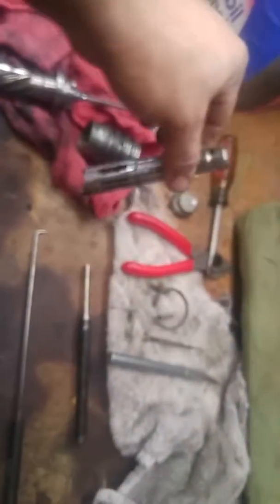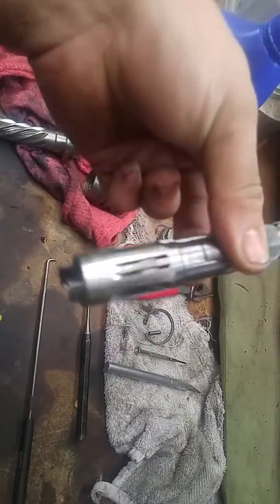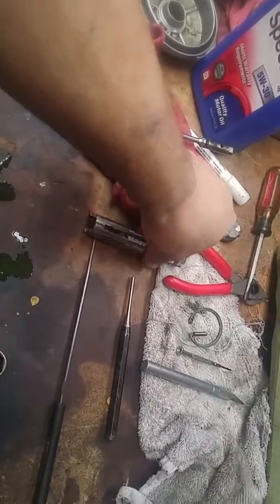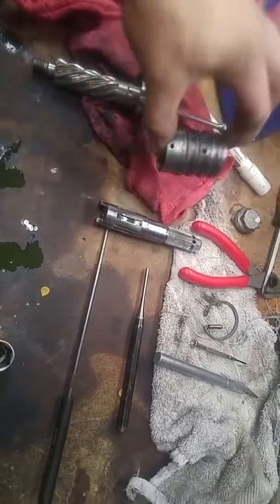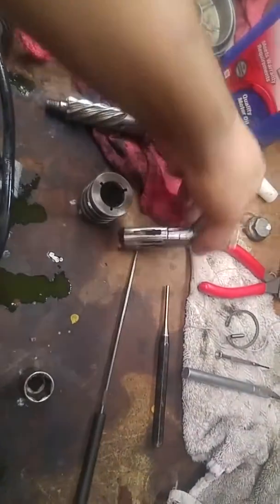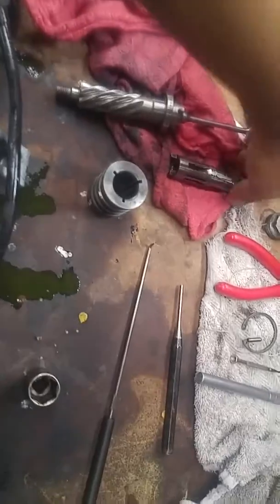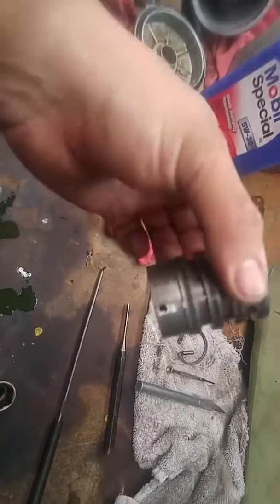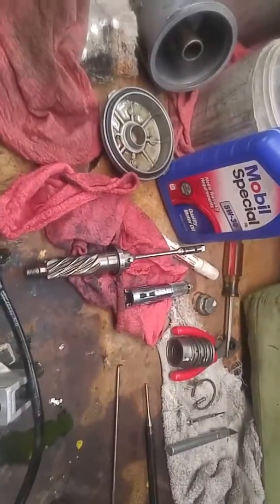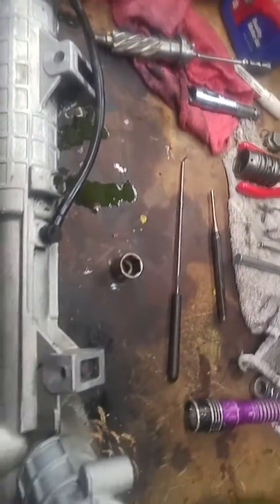And then on this shaft, I guess we're checking it for wear like you would on anything else. Well, what I noticed is I air checked it because it kind of looks like a clutch pack assembly the way it works in the transmission. This should have a pretty decent seal as it goes in through here, pretty close cut machining wise. But I noticed air leaking out of the top portion only through one of the chambers, so I assume that's probably where our leak is, if there was one. I just dismantled it just to do it. But yeah, it's pretty straightforward.